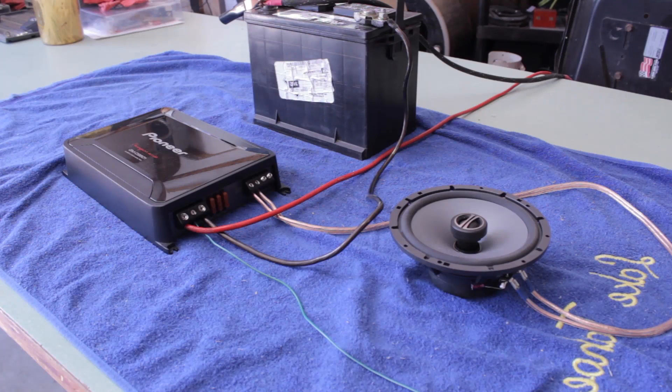I get a pop when it turns on and then a hiss, and I can't figure out the problem. I tried everything — tried all the remote circuits, had a relay to turn all the remote stuff on, switched ground cables, checked all the ground impedance, switched power cables. I finally put the battery in the trunk and hooked it up directly to the amp rack, but that didn't solve anything. So the last thing I could do was take the amps completely out of the car.